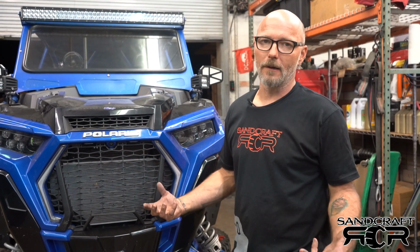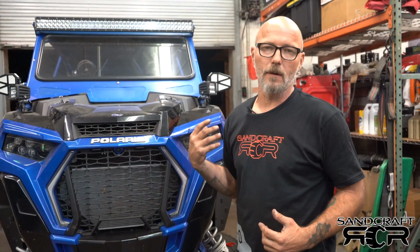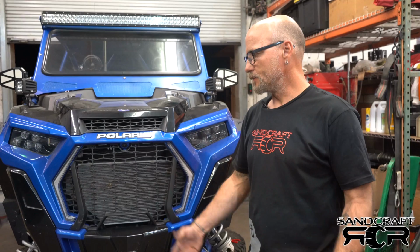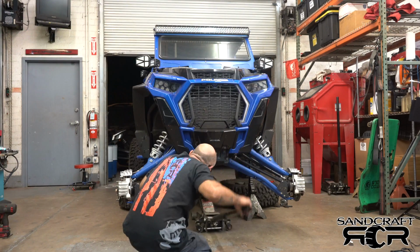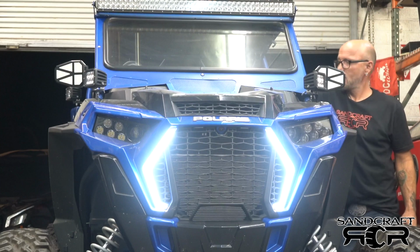Let's just go ahead and do another recap on what we've done. Just take your time, enjoy the process. Make sure you have free-flowing movement through the whole thing before you give it a final torque. Pretty much all we really need to do now is jack this thing back up, put the tires on, and we're going to set the alignment.